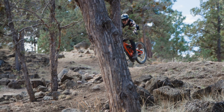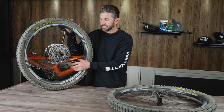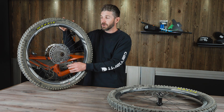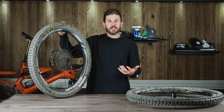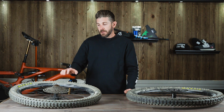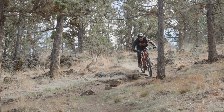When we first got these wheels we were a little skeptical about the 28-spoke build, thinking we might need 32 given the added weight and aggressive riding style we'd put this Specialized Levo through. We very quickly found that if you can build a 28-spoke wheel correctly, stiffness is not a concern. We asked FSA why they didn't go with a 32-spoke build and they sort of smiled and said they tested it and it was way too stiff. Based on the stiffness out of this 28-spoke wheel, I definitely believe them — it is a pretty stiff wheelset as it sits.